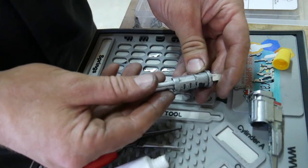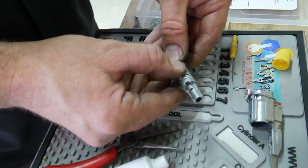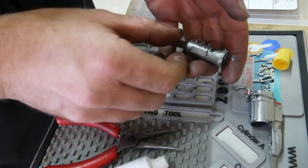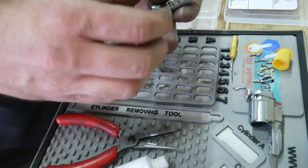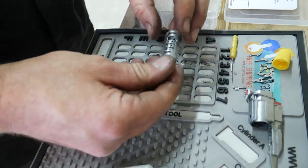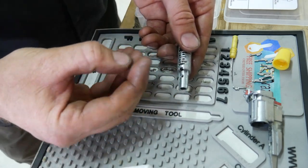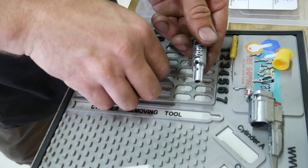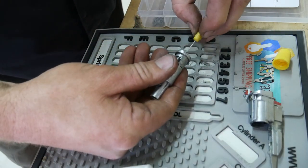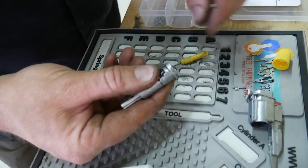And I'm just verifying that none of those tumblers are sticking up out of the cylinder and they are all in there perfectly flat or just below the surface. Now, some guys will remove some of the tumblers so they can, I don't know, save money, do the job easier. But it's not as secure if you remove some of the tumblers. Okay, I'm just gonna hold those in place, flip this over, and stab all these other ones in there. Okay, stick our needle in there, wiggle it back and forth while I'm holding pressure on the tumblers. They all went down in there all the way.